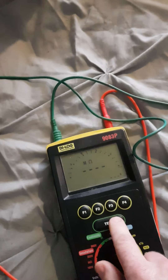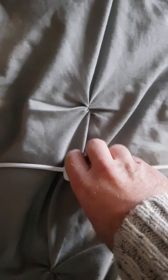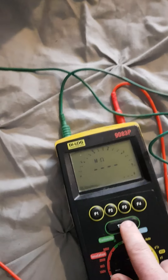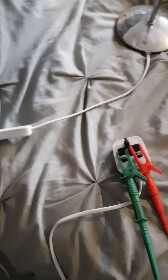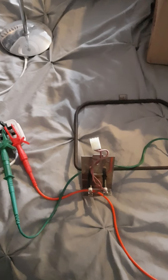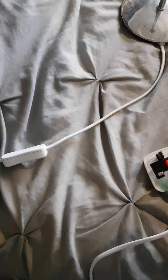Between the two terminals we've also got very good insulation because the light's off. If we switch the light on then it will fail an insulation test by giving zero — no surprise there. What we want is a reading greater than 200, or for the RCD in your house not to blow it needs to be a reading of greater than about one. Now we'll take these probes off and put them onto my broken element.